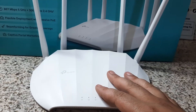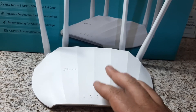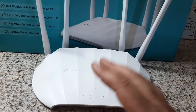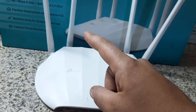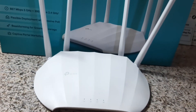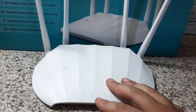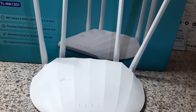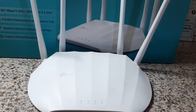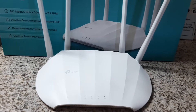What Wi-Fi 5 is doing is it's going to have the same wireless n technology built into it for the 2.4 gigahertz band — so it's like half of it is the existing standard, but you'll probably have better signal from the taller antennas. And you're going to have the new 5 gigahertz band, which is going to be able to push a lot more data and bandwidth through than you can on the 2.4.